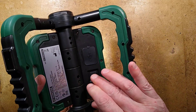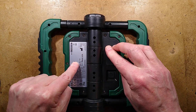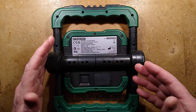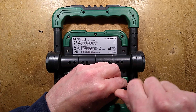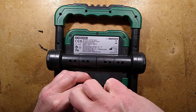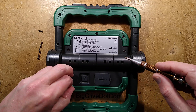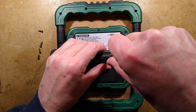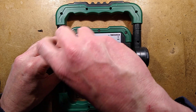Let's take it apart. I'm going to guess that all the electronics will be in here, and the batteries will be either in this section or down the middle. I'm wondering if it's going to be 18650 cells because it does say 5000mAh - and 2500mAh is a fairly standard value for a single 18650. These screws here need to come out too, which kind of rules out the possibility of 18650s in the middle because they don't generally put screws there.